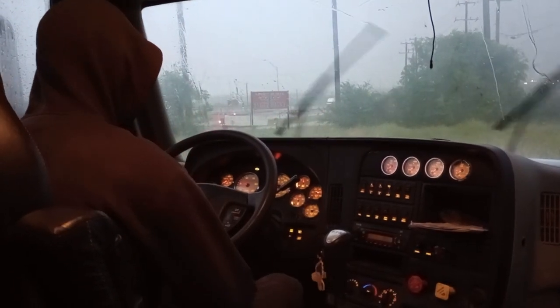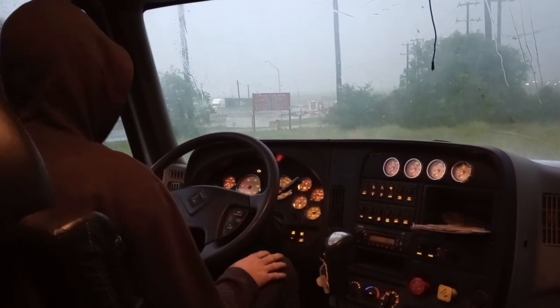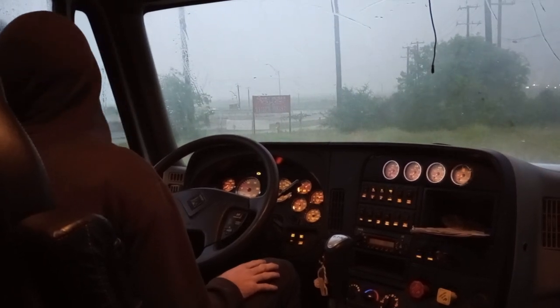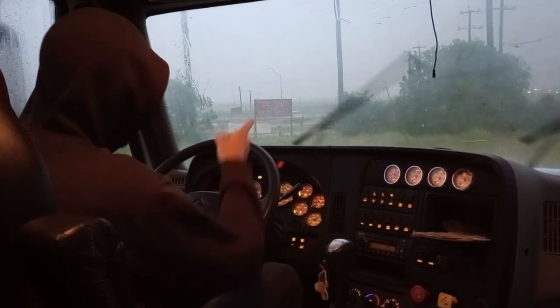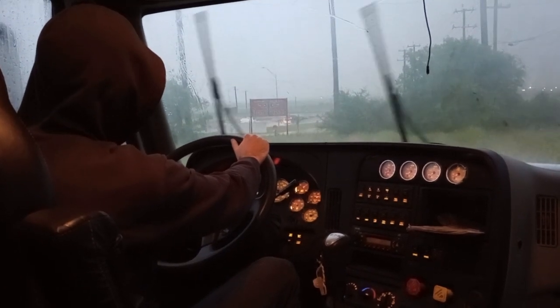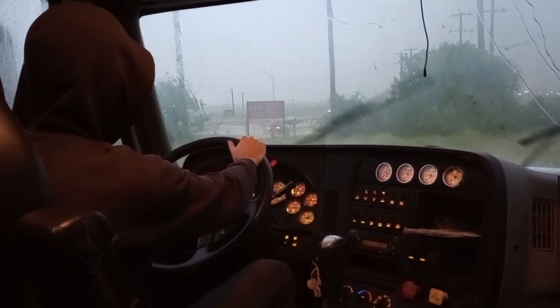the clutch. Okay. After that, I would check my mirrors, which are properly mounted, secured, no chips, cracks. It's clean and it's adjusted to me. After that, I'll check my windshield. It's properly mounted, secured, no chips or cracks. It's clean and there's no obstructions or illegal stickers.